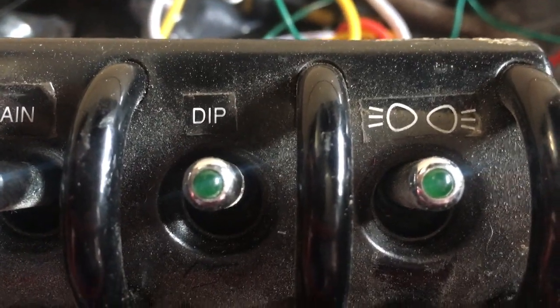It's not quite what I wanted. So what I thought from reading the instructions before was that the wire that's meant to go to the brake pedal was going to be the signal to when you let off the brakes, stop the starter. Obviously that's not what happens. It just runs the starter for an amount of time it thinks is okay, which is not okay for most things. And then I was going to do something clever with the ECU to make that work, but it doesn't look like that is going to be an option. I might still use it because I like the button and I can make it work, but we'll see. I've also just worked out how the alarm slash immobiliser on it works, and that's quite a nice little feature actually, so I probably will use this.